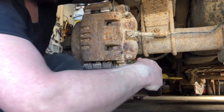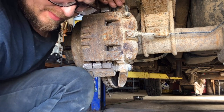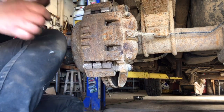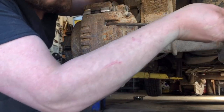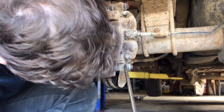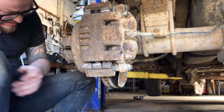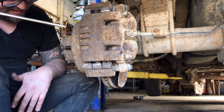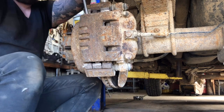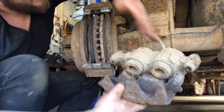These calipers fit into a slot up top, so you've got to — sorry about the traffic driving by, it's a nice day — you've got to take the bottom out first. There's no peek hole to help press the caliper. On this side, the bottom fits in, so you take the top bolt off first.